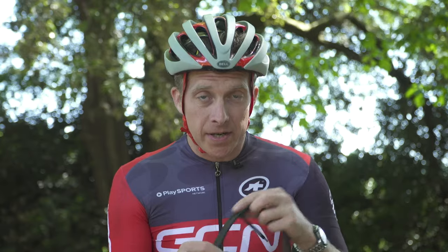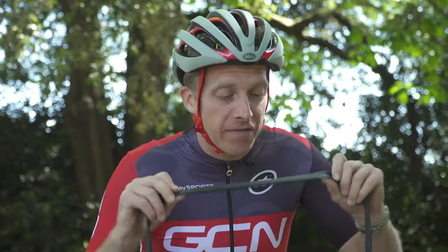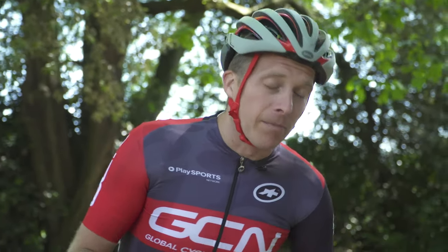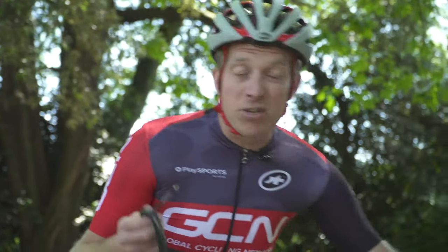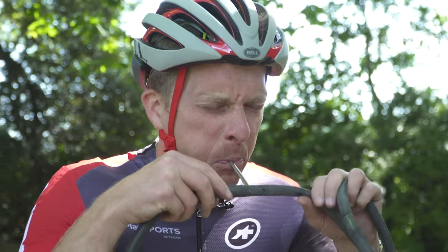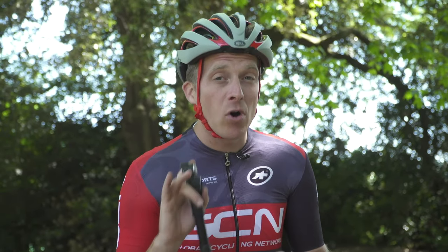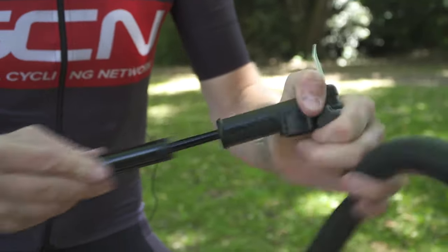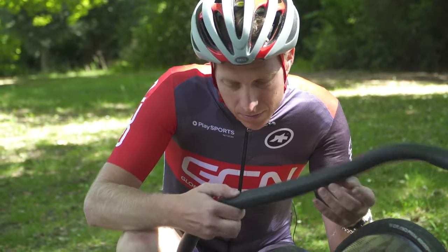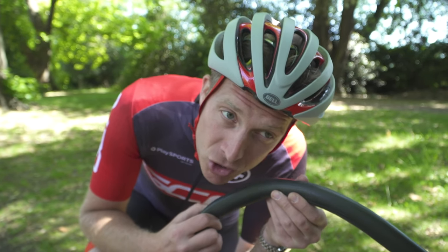Now you've removed the tube from the tyre and the wheel, it's time to find where that hole is. You could spend a great deal of time looking at the tube itself, but holes tend to be the size of a pinprick and they're not that easy to find. That's where your mini pump comes in handy, or alternatively even your mouth — you can in fact inflate a Presta type valve by putting your lips around it and blowing. You're not going to get up to much pressure, but just enough to find the hole. This is one of the reasons I always advise taking a pump on your ride. This hole was absolutely tiny — I had to inflate the tube by quite a margin and hold it up to my face to feel just a tiny little stream of air coming out.